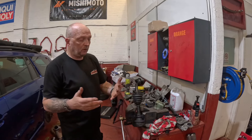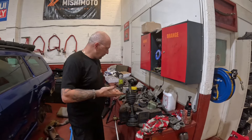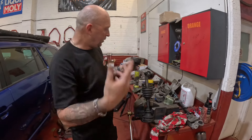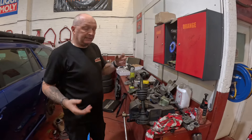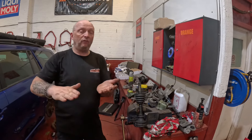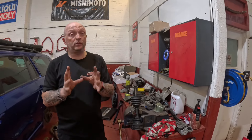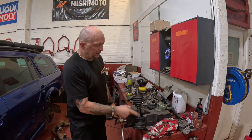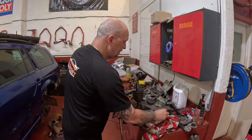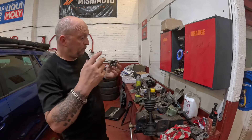We hammered the living everything out of it and it wouldn't separate, so we cut the top off the shaft. We then twisted the cage because we'd cut the shaft and got it out. It still wouldn't come apart enough, so we cut the top bit where the recess is for the clip as well and then got the shaft out. This proves to be worth it because the Mondeo shaft is the one where the joint came off easy.